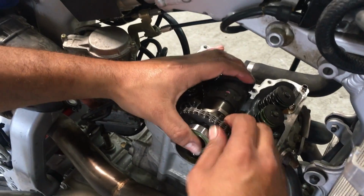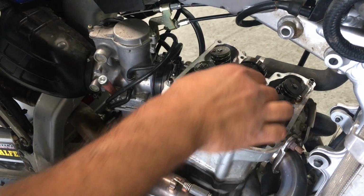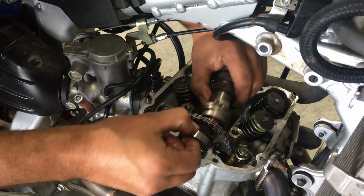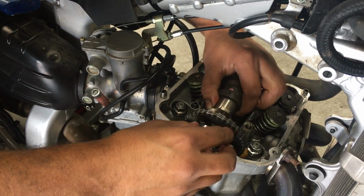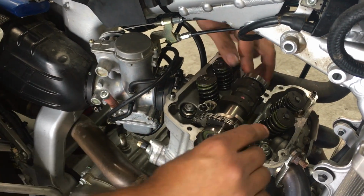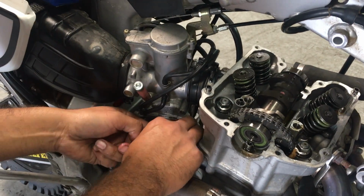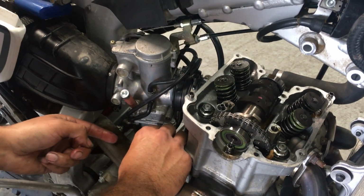But once you go to there, and this bike has a pipe on it, now it's the perfect bike to put a cam in, because the stock cam is designed like a trail cam. The idea is first, second, third gear in the trails, fourth and fifth down fire roads to get to the next trail, so it doesn't have a lot of mid to top end overrun.